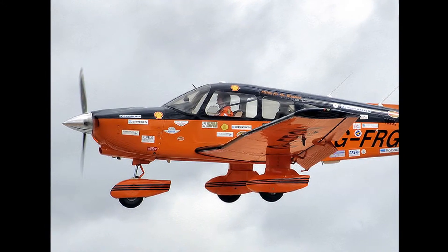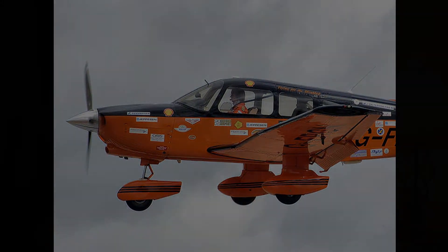However, when you got in flight, you can imagine where I'm going with this. Say you're coming in for a landing and you have a right crosswind. You're banking to the right, but what are you doing with the rudder pedal? You're kicking left rudder to keep what I call the longitudinal axis aligned with the centerline — otherwise you're coming in crooked and you'll have an issue on landing. With the direct-connect nose gear system, if you have the right wing down and left rudder in, that kicks the nose gear off to the left.